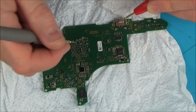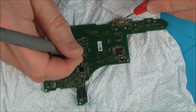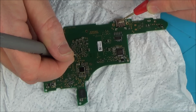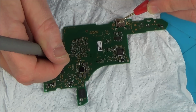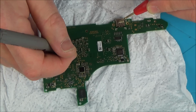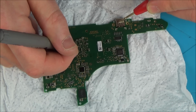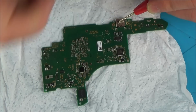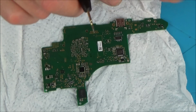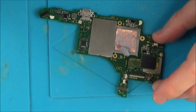Okay, obviously I haven't gone across every single one of them, but as far as I can see, the ones I've tested, which is quite a few of them, they're all just shorted on one side, which is normal. So I think, just from first impressions, it's just that one capacitor on the other side which is looking to be incorrect. But when I get that one working, possibly there might be a huge range of other faults, but maybe not. So what I'm going to do to begin with is take off the capacitor, because I think that's the easiest thing to do.